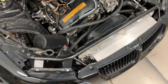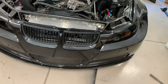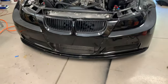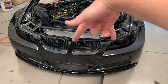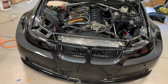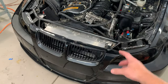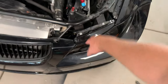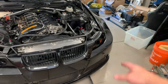This little modification here — this is running a tubular front structure. So the whole thing, everything is supported off of this tubular structure. If you go all the way down underneath, which I can't get to because this thing is so low, there are actually two connection points where the front splitter will connect on the bottom going into the tubular frame structure. Fully adjustable. The headlights are just headlight blanks that have the ducting in there — one for the turbo, one for the power steering cooler. Goes right in there.